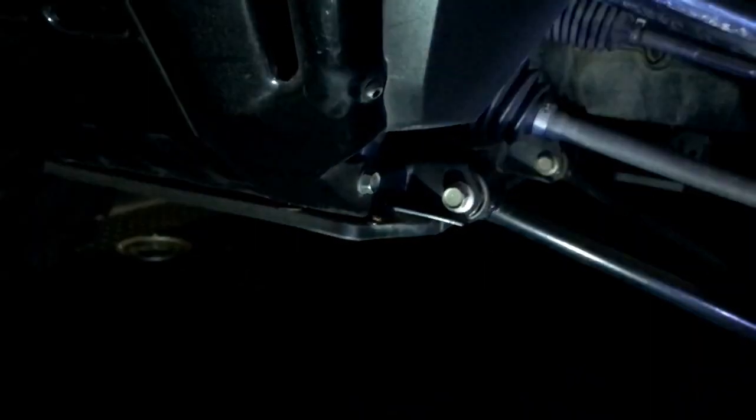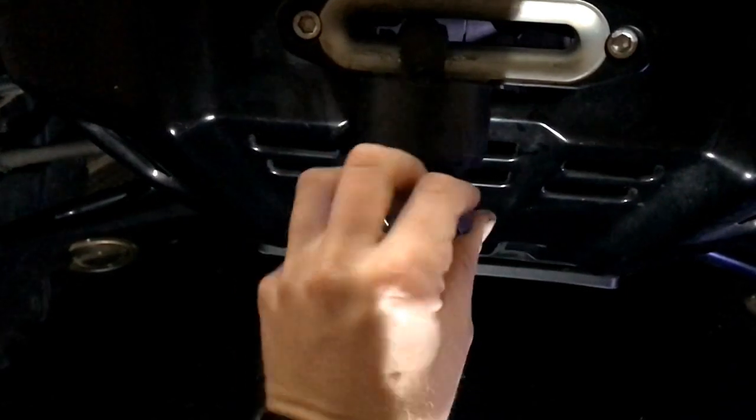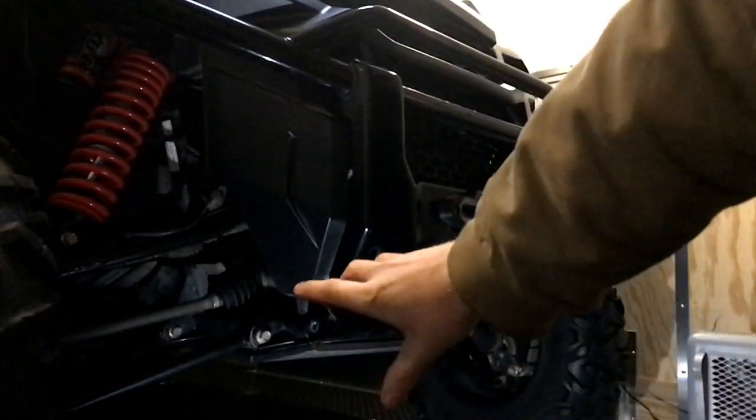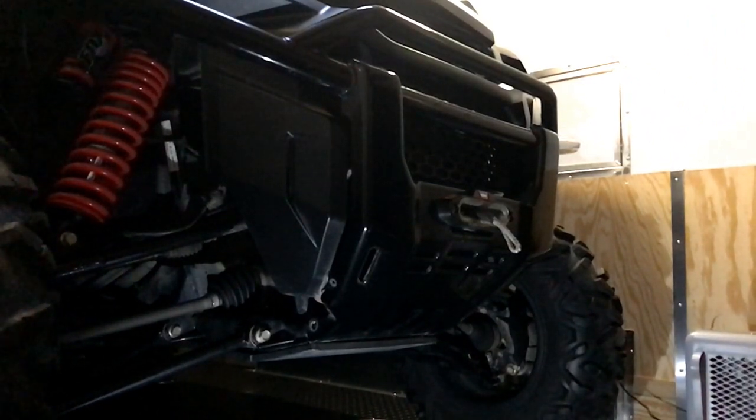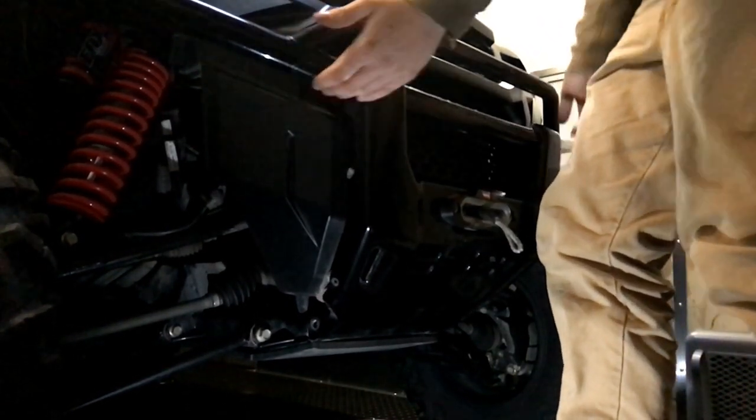To get the plastic off, there's a little bolt here — you've got to use either an allen wrench or this allen wrench socket, five millimeter. This side is all the same as the other side. There's a total of six big bolts and two of the little allen wrench bolts. Take this out, pop the pin, my hook came out, pull my rubber off, have all the bolts completely out, and it's ready to come out. Just gotta grab the bumper, wiggle it up and down, and pull — it should slide right out.